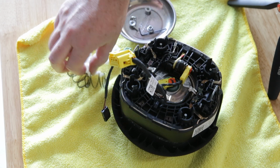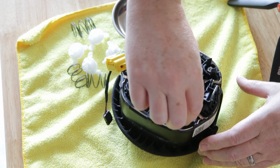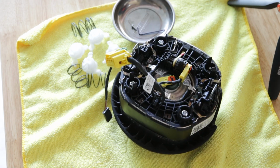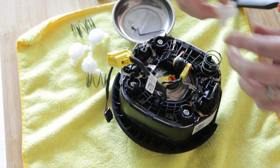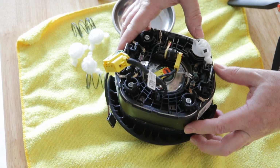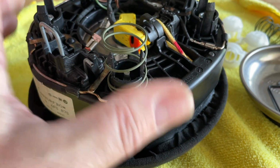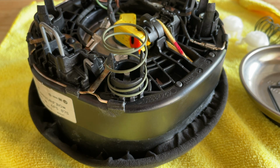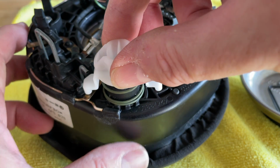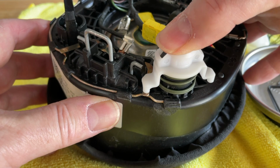Next, it was the 4 nuts on the airbag studs and the sprung horn buttons. The white horn actuator buttons snap into place, and note they are symmetrical with small arms to activate the contacts for the horns at all 4 corners. With those in place, the swap was complete, and I'm now ready to install the airbag with its new stylish cover back into the steering wheel.